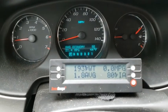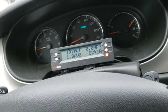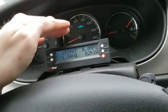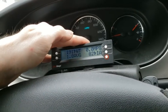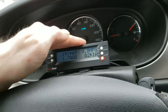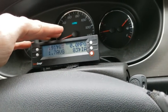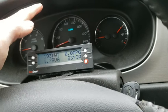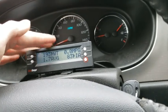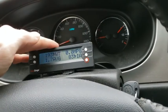On a 44-degree day, my air intake is reading 80 degrees. This gets to the key discovery I made while driving. The car has the factory air intake from Chevy with a K&N filter in it, drawing air from behind the driver's side headlight. The problem is heat soak. I drove the car until it warmed up to about 200 degrees, stopped at AutoZone for 15 to 20 minutes, and came back out on a 50-degree day to find it reading 130-degree intake air.